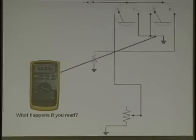All right. How about that voltage? Now, voltage drop of, what are we reading? What scale, Mr. Painter? We're reading 40. I'm sorry? What are you reading on what's there? The reading? 2.3 volts. Someone help him out. He's close. 2.3. There's a different way of saying it. 2 volts, 30 millivolts. 40 volt scale or 60 volt scale.